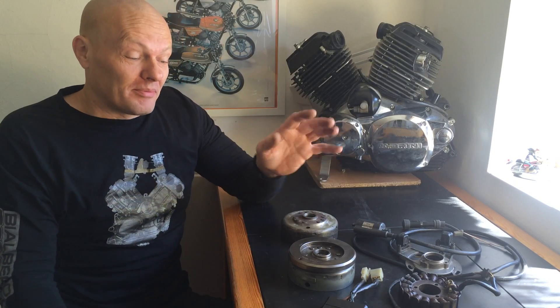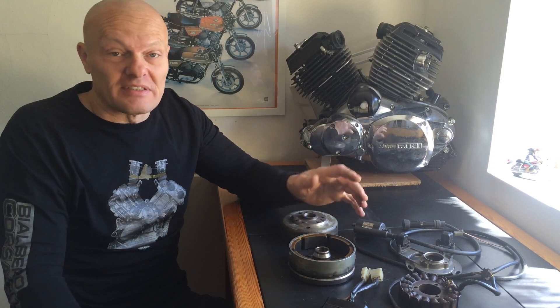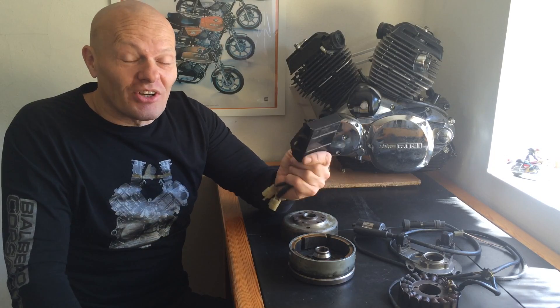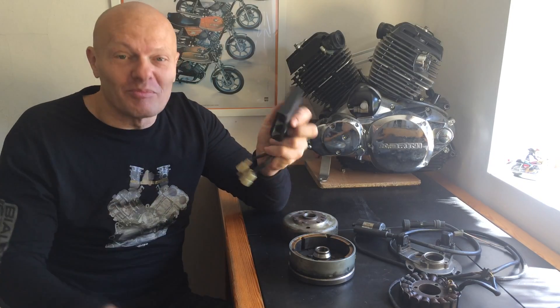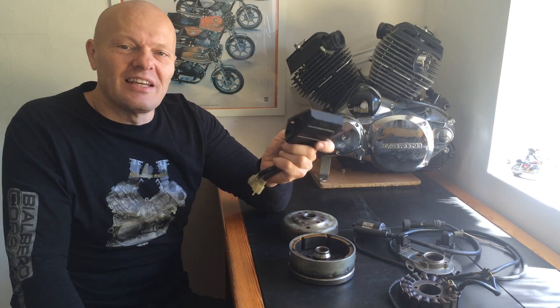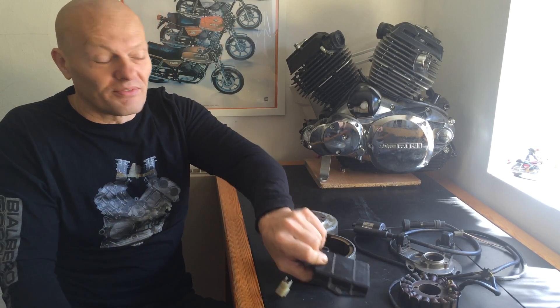Apart from the mentioned problems — and especially with the magnets coming loose — you will probably never have problems with the system and won't need any parts. But in the event you need the CDI unit, don't get suckered into buying an overpriced unit simply because it's an original Morini unit. I've seen them very highly priced out there, but it's the exact same thing that went into the Suzuki GS500. You probably know the bike because there are so many out there — in Denmark it was the most sold bike for 10 years in a row. So there are plenty out there and you can get them for a very low price.